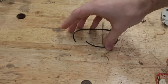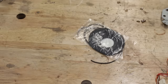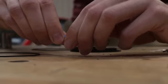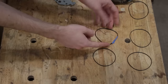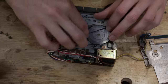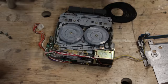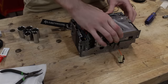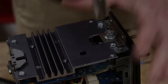However, you can't exactly buy a 1985 Pontiac Fiero tape deck square-cut belt all willy-nilly — at least not without getting more than you need. This assorted pile of tape deck belts was only $8 on Amazon. Considering that this is the only expense necessary in order to fix the radio — not including the $3 worth of capacitors I ended up not using — that's really not a bad deal. So after finding one that looked to be the right size, I slipped it over the two large capstan pulleys as well as the motor pulley. Assuming that this is the whole problem now fixed, I guess I can go ahead and put the entirety of the radio back together. But, why don't you guys take a quick look at how far the playhead is for this video?